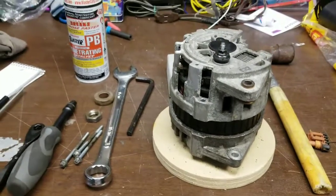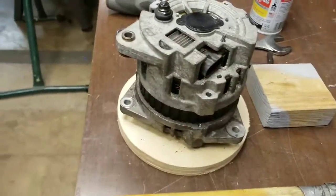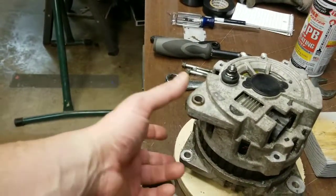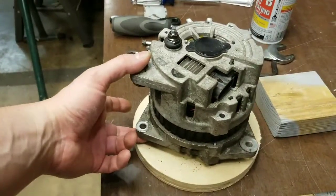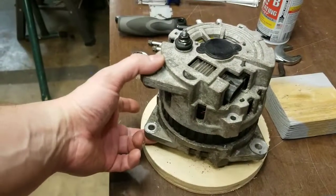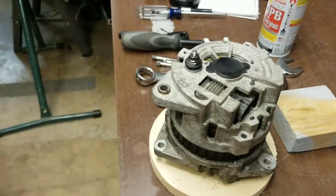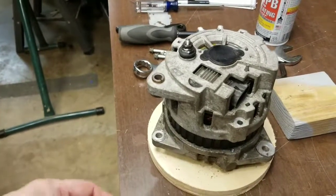What you may hear is the term re-clocking. The alternator in its current configuration has a mounting ear here and two mounting ears here. That's the configuration we're looking for on the MG, but it's in the wrong orientation — these are on the top, and if you were to mount this in your car it wouldn't give you the opportunity to use the secondary mount to adjust tension.